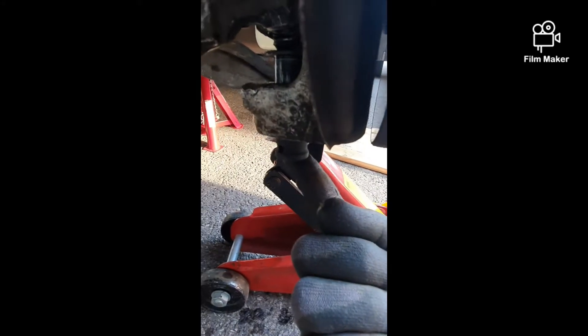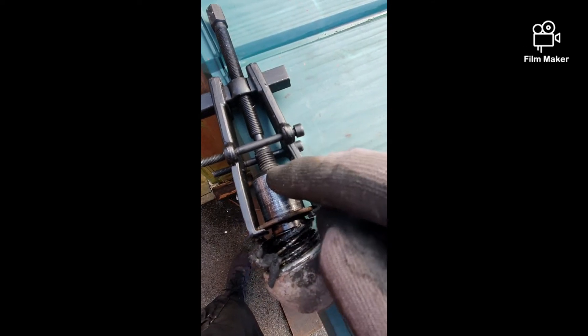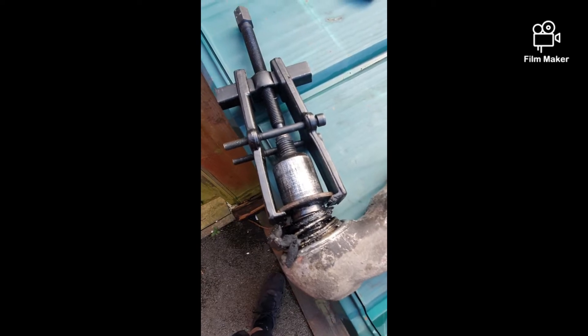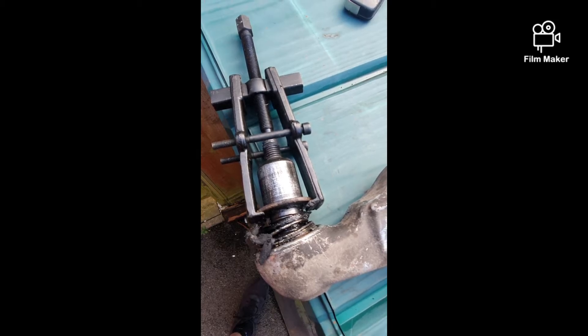So then, once stage one is complete, stage two. Stage one is complete — take it out — now to pull off the hardened steel sleeve. I've been soaked it in WD-40. I thought it does rotate a bit, so I'm going to clamp it in my workmate so I can just pull on the pressure and hopefully it should come off. If not, I'll apply some heat to hopefully expand the hardened steel sleeve and get results there.